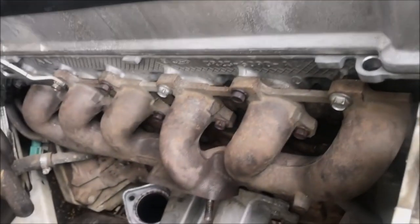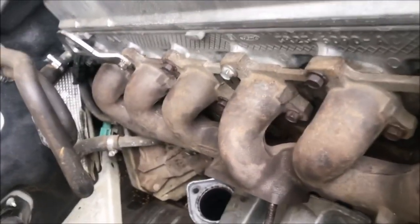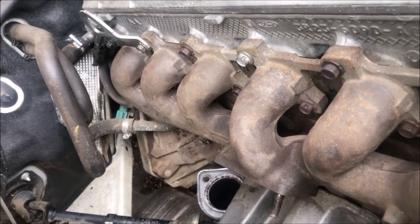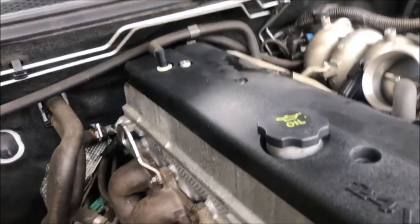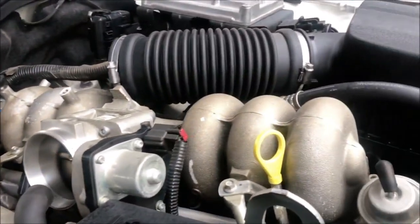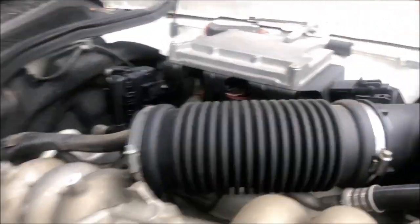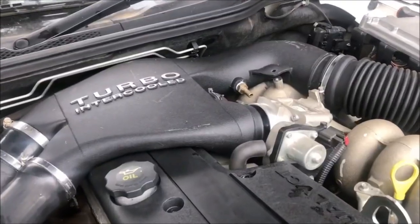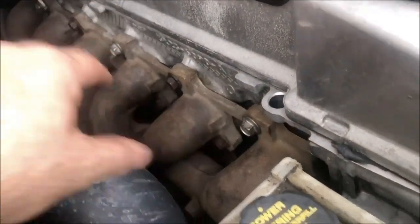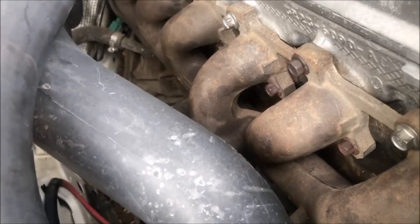Exhaust manifold is on and on for good. One thing I'm yet to confirm is where the water feed comes from for the turbo. I want to confirm that the crossover pipes all line up with the NA setup — mainly that one there. Yep, that's going to work. I was thinking of cutting up the original heat shield off the header and making it work around this area. I do have a cover for the turbo, but I don't have the factory replacement for that vehicle.